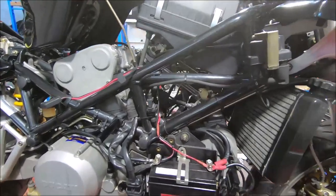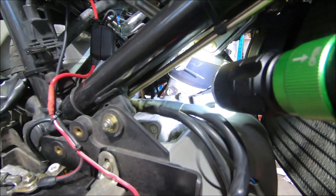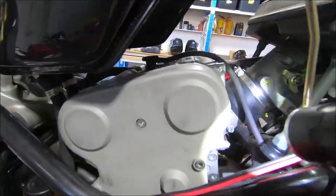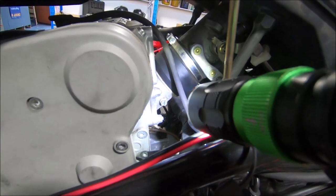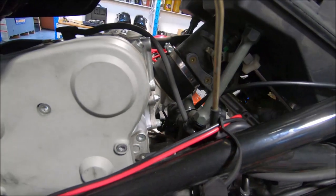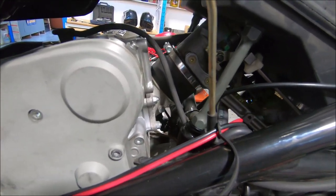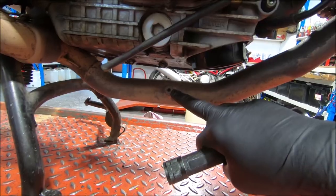Looking around it, things we're going to do is, there's a little screw there. That's the balance port screw for the horizontal cylinder. And there's a similar little slotted head screw there. That's the balance screw for the vertical cylinder. I call it balance. Some of our American friends might call it sync or synchronization. It's just a word.